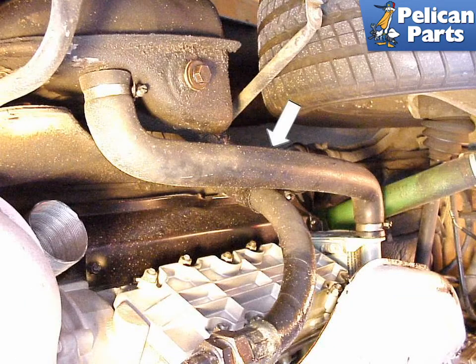The line that connects the oil tank to the engine needs to be completely removed, illustrated by the white arrow. Two hose clamps connect the line to the bottom of the oil tank and the bottom of the oil filter. Inspect it carefully upon removal and use a brand new one upon reinstallation if there are any cracks or the hose is brittle. Have a drip pan ready as excess oil in the line will spill out when you remove it.